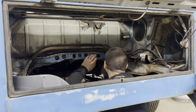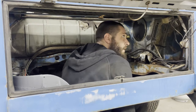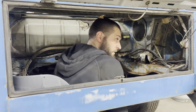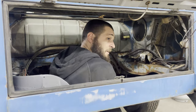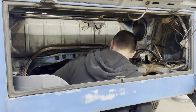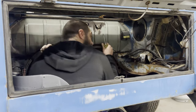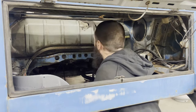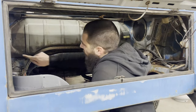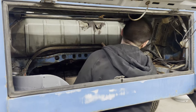It's another day. I've got to get the fuel tank out of here, and whether you like it or not, the engine has to come out to do that. At a minimum you have to lower it. If you're going to lower the engine, I suggest disconnecting the shift coupler from the transmission because if you don't you can ruin it. In order to get this panel out, there are one, two, three, four, five, six screws.